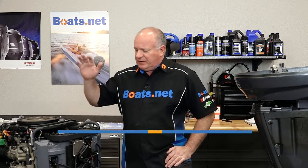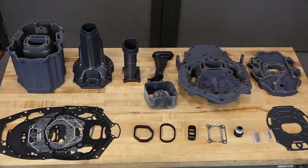Now if you've been keeping up, we actually have rebuilt the engine and the lower unit completely. The only thing standing in our way now is this midsection. It looks like somebody has gone in and installed a kit on this particular engine, but I can't trust that. So let's step over to the table and take a look at that one part number that has 22 different parts inside of one big box that addresses the corrosion issue for this particular make and model.